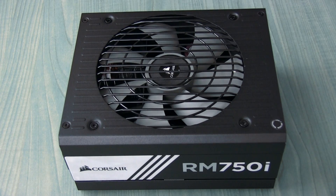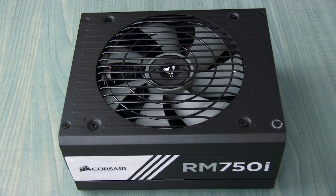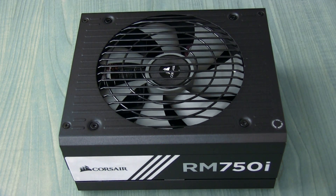There are a few things that computer modders and enthusiasts would be looking at. First, the fan used on the power supply — this is an oversized 135mm fan, which means it can spin slowly and produce less noise while providing the same airflow as a smaller 120mm fan. Definitely a welcome addition. The gray, unassuming color will fit the majority of color schemes that potential modders would be using, and the silver and black label will also interfere less with most builds.